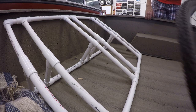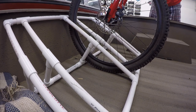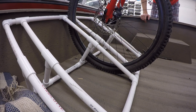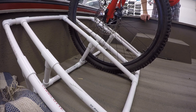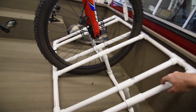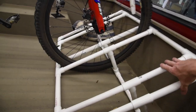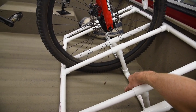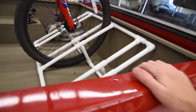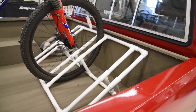Let's see how this fits — I'm liking this better already. The bike sits down in there better, that's going to be a lot more stable side to side because you have a lot more of the tire inside the rack, and there's a little extra room for a larger tire as well. To avoid confusion: Instructables had some pieces listed as 10 inches in the instructions, and I took a guess that they meant those vertical ones were 6-inch. If you follow the instructions, those last pieces should actually be the 6-inch size — at least to fit in my bed. Each truck's a little different, that's why you put it together first without glue, make sure it's what you like, then go back and glue it.